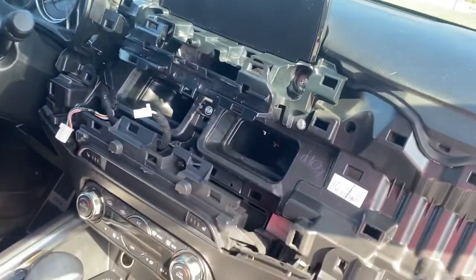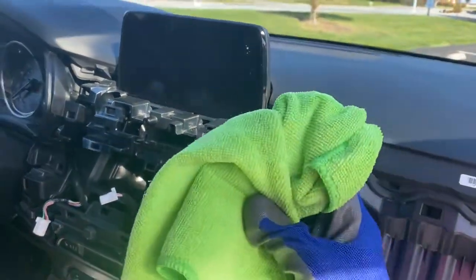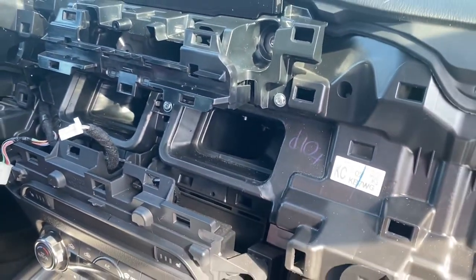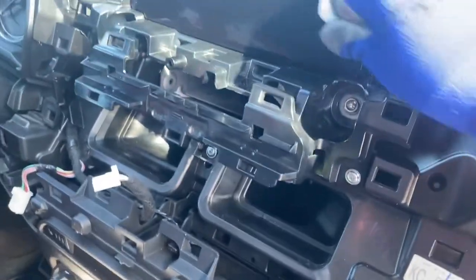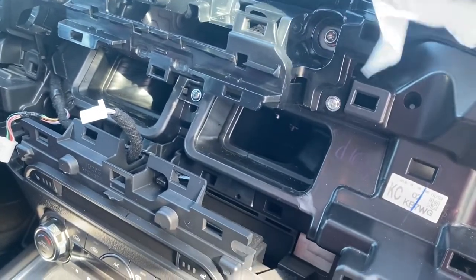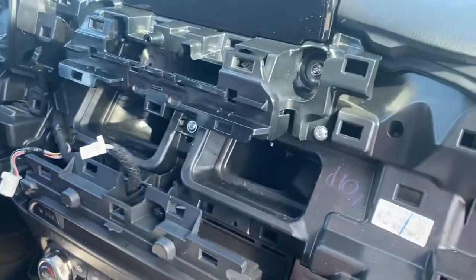After you do that, get a piece of microfiber cloth, dry it, and look at it. You have to play with it — it's not gonna let go in one minute. You can go in a circular motion or back and forth. If you try two or three minutes you'll see it's gonna remove that anti-glare coating.